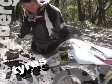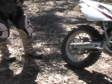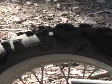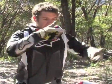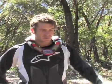And this is the standard FIM street legal tyre, and as pathetic as they look with the tiny little knobs, they're actually good, especially on the hill climbs. They allow enough wheel spin to keep the motor in its power zone, but there's still enough traction to keep the thing pushing forward, because you want the tyre to work like a trials tyre, where it just folds itself around the rocks and grips it. Basically, tractability on the rocks, especially if it rains, is everything, and you depend on that little crucial point of traction.